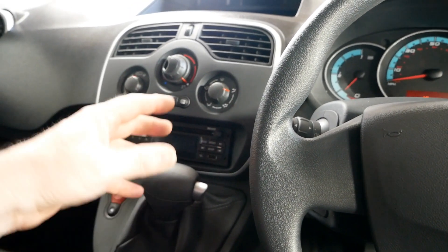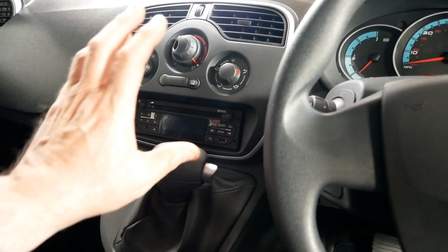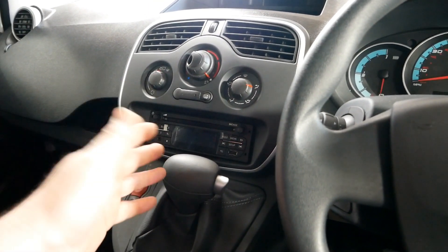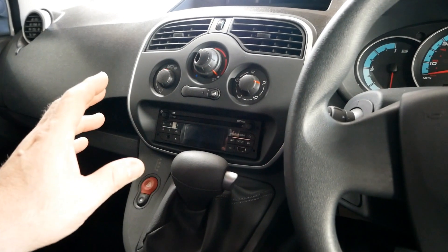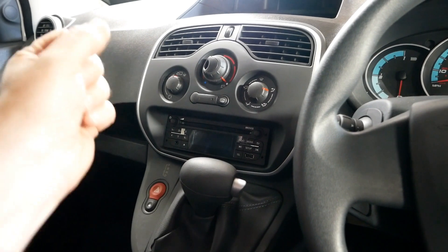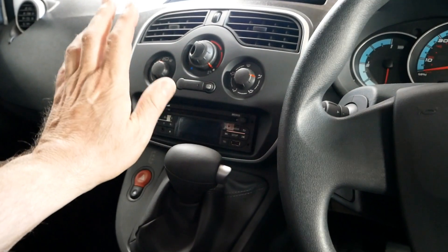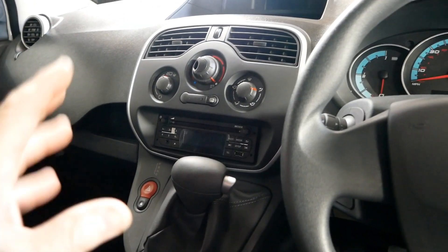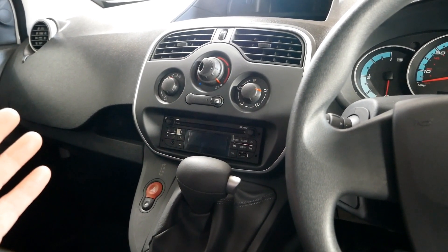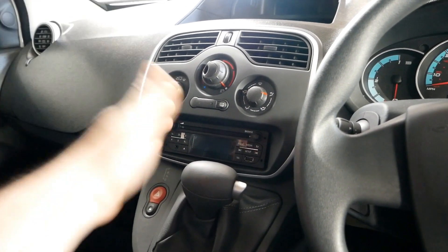People who've got used to driving EVs really like the regen. In many vans — certainly the Kangoo, the Citroën Berlingo, and Peugeot Partner — they don't give you any adjustment on the regen, but they've set it up to have maximum regen, a bit like a BMW i3. The only one that's different is the Nissan e-NV200, which gives you a B mode, but even in braking mode that single level of adjustment is still not as strong as the standard setup in a Kangoo van.